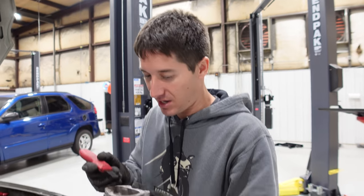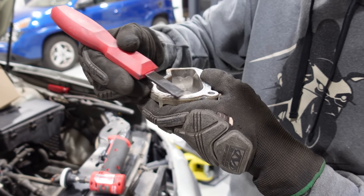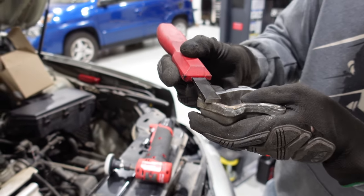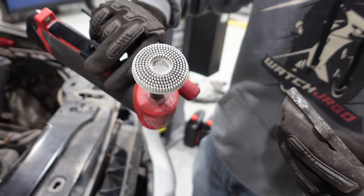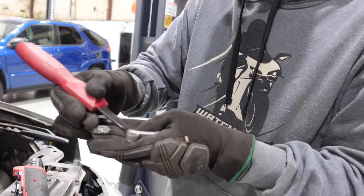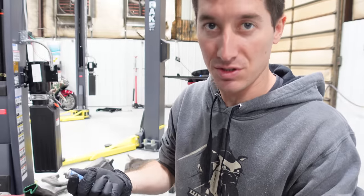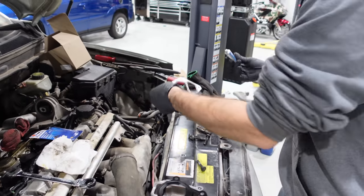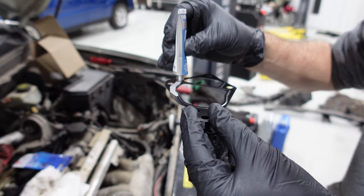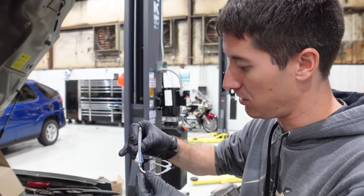Back in the shop with my new thermostat housing cover. We've got our carbide gasket scraper and this is working pretty well — you can see all this old gasket material coming off very quickly. I've got the Milwaukee here so we can use the bristle brush, but it's about done — there's not any bristle left on the brush. So hopefully the carbide scraper gets it. Here's our water pump RTV from O'Reilly's. We'll lay a bead down — this is gasketed so it doesn't need much RTV, just run the whole sealing surface like that. Whoever did this before put so much RTV on it — the squeeze-out was massive. You do not need that much RTV.